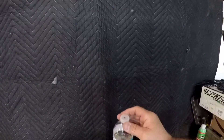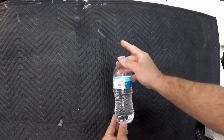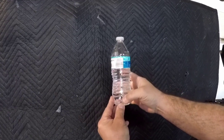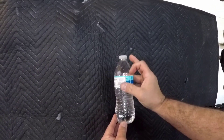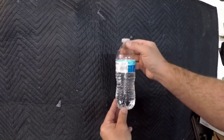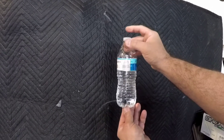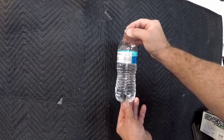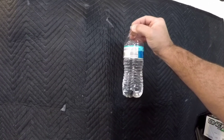Here's why we have a vent — there are two reasons. The first reason: if you don't have a vent, as the liquid goes down — which would be your gasoline — you create a vacuum on top. You have no air coming in to displace that space, so your fuel flow will stop. Watch what happens when I plug the vent while feeding the carburetor.